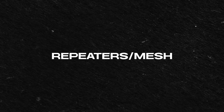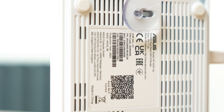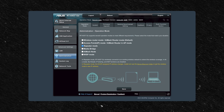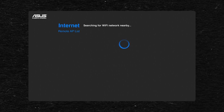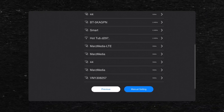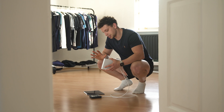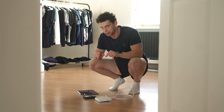But with a second travel router we can take this a step further. What if I wanted to create a mesh system of Wi-Fi inside my house to enjoy that free Wi-Fi all over the house? So I'm going to connect to our second travel router. All of the connection info is plastered on the bottom of these devices. After logging into our Asus travel router, you can see I've got this in wireless repeater mode. We don't want to put this one in router mode because we've got our GLiNet upstairs taking care of internal routing using the free Wi-Fi as its internet source. This thing is now displaying us the list of Wi-Fi it can find, so we're going to connect to the GLiNet, put in the password, and this thing is basically now acting as a wireless repeater. I'm going to leave this in this room and go into the games room downstairs and still see if we have free internet access — it's all over the house via these small battery-powered devices.